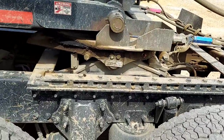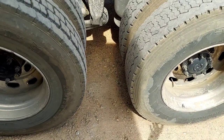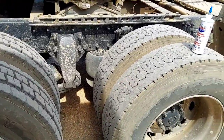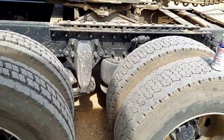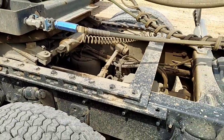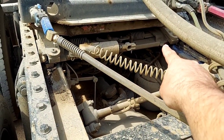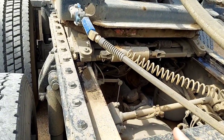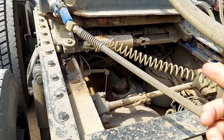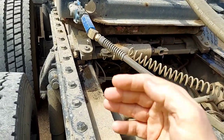Now that we've got that established, another thing I'm going to do is lock my axles together because I'm on dirt, loose ground — uneven ground. You want to lock your axles; it makes it easier on everything: your clutch, your axles, your trailer. Then I'm going to throw the switch inside to unlock the actuator. Sometimes this does not come all the way out and unlock, so I have to move the truck forward or backwards to get those three fingers to retract on both sides. To relock it, you'll move the truck back and forth so those three fingers find their happy place.